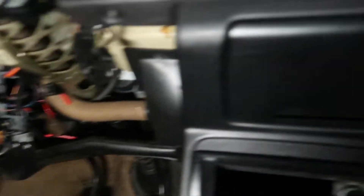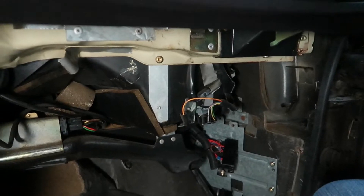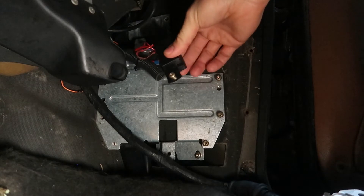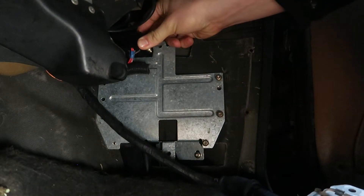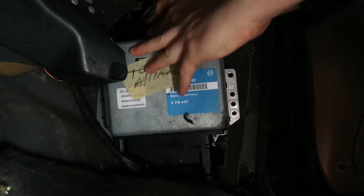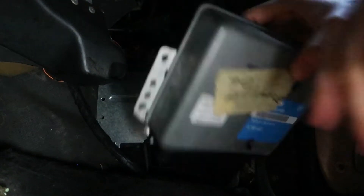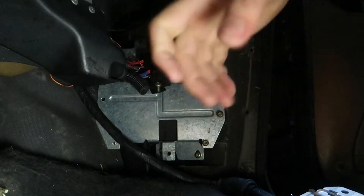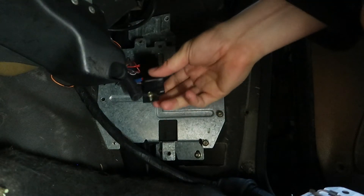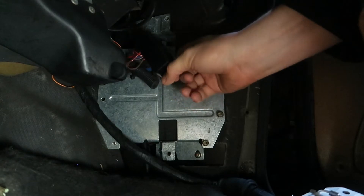I removed the lower dash pad. This isn't required to get to the fuel pump relay location — I mostly did it for my own curiosity and to see if I get any more leg room. Removing the lower dash isn't required, but it definitely makes getting to this a lot easier. If you don't take it out, it's all the way back here, and the ECU is mounted right here with the dash pad coming right up to it — there's no room to reach your hand in there. You need to have six different limbs on your wrist to reach it. I've done this before, which is why it's already off, and I'm not going to reattach it because of just how hard it was to remove.